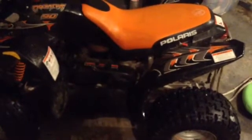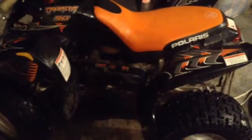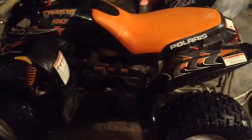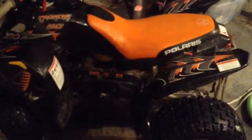I was able to go faster. But within a second or two, the RPMs shoot up really high. And after riding the bike for about 5 minutes or so with high RPMs, while pulling my kids around on sleds, I had like a soft freeze on the engine, I guess, because it started up again once it cooled down. It's overheating because it's revving really high, and it's not shifting, I guess. So the 4.5 gram sliders are just not really working for me at all.